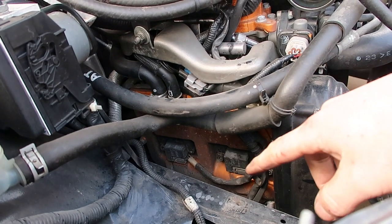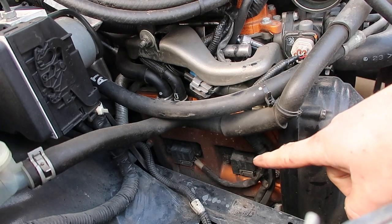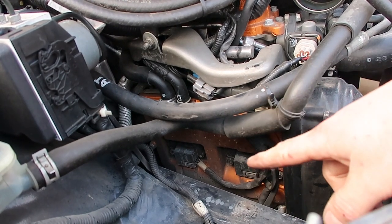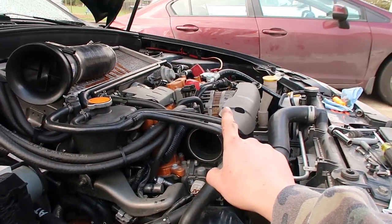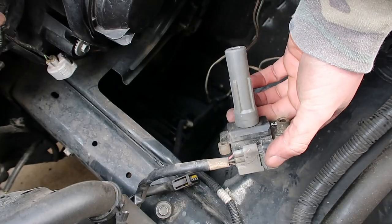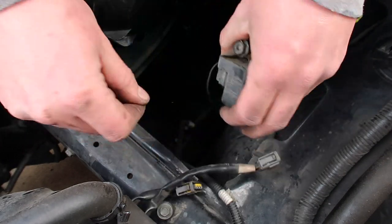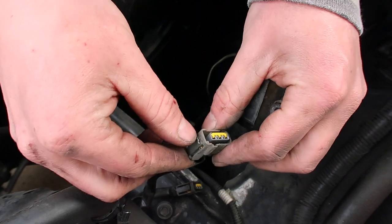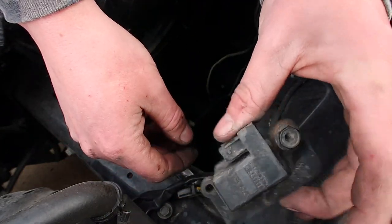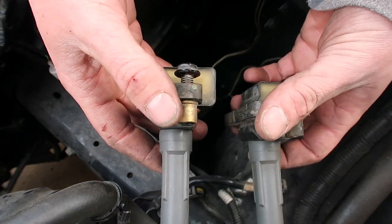Now we've got a clearer idea of what we're going after. Here is your ignition coil — it's held on by a bolt, you pull those out, and your spark plug is right behind it. We'll unbolt it, disconnect it, and pull our spark plugs out. This is the passenger side. Important to keep your air intake with you because you'll need your MAF sensor. We've got our ignition coil out with a 12mm bolt or hex, and it's connected — I don't want it connected because I don't want anything firing while I'm trying to start it. Pull this tab up — it's a pull out, not a push — and it just pops right off. I keep these in order by how they came out, rear and front, and put them on the shock tower for later.